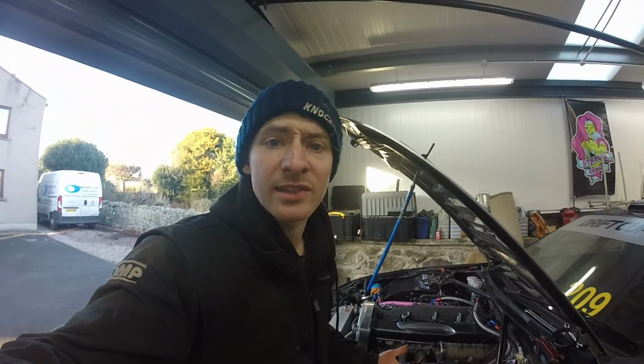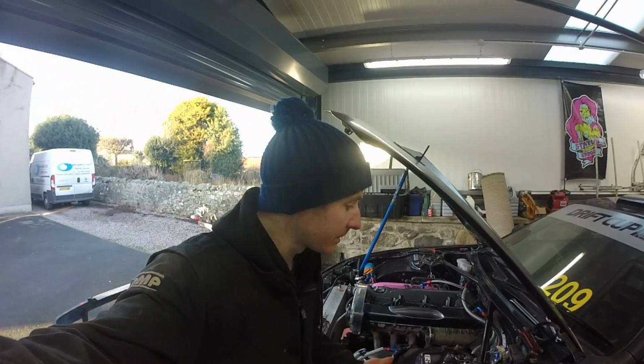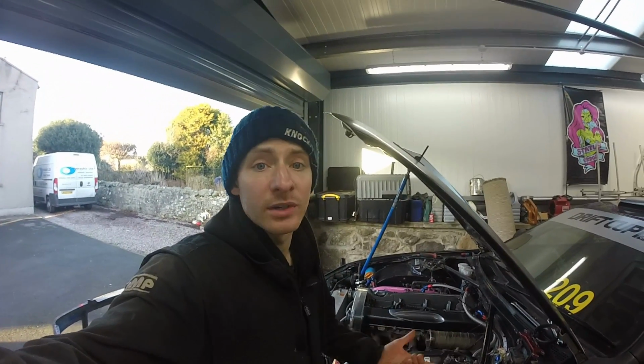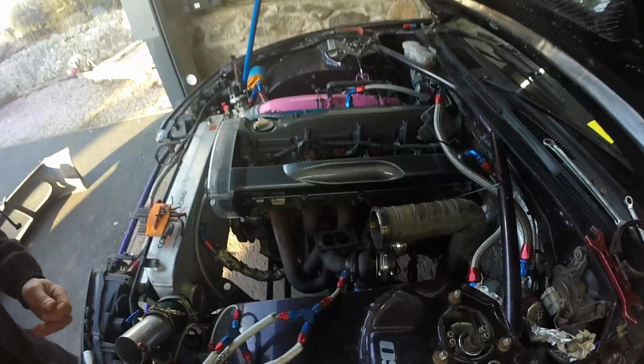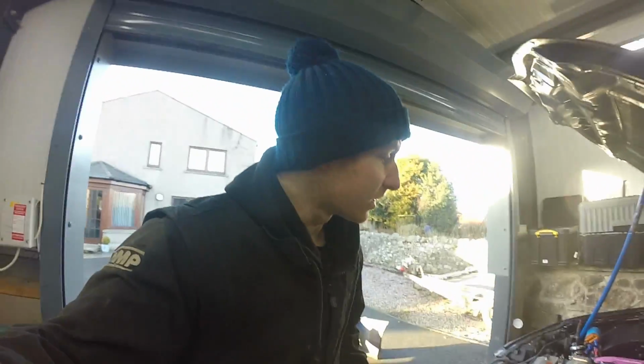Last time I was on the dyno as well, we found that the turbine housing that I put on, if you watched my last Pro 307 episode about more power and faster spool up, we made more power, but we felt we could have done with a bigger turbine housing. So as you can see, wastegates are rebuilt and I need to get a new turbo on.